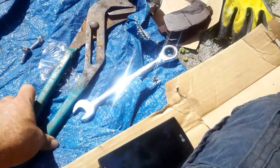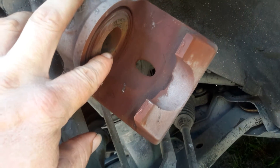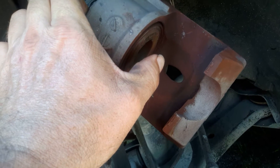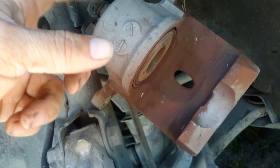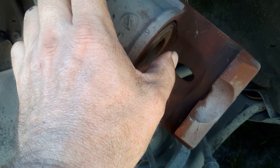Take your large pliers and you're going to compress this piston. It's best if you get a piece of wood on it so you don't damage the surface. Just grab it here and here and squeeze — you're going to have to squeeze it hard. You could probably even use a C-clamp: clamp on the back side, piece of wood, and turn it. This will slowly compress all that brake fluid and it's going to go back into the brake reservoir — the one we just opened.